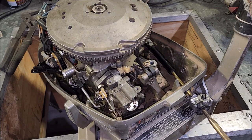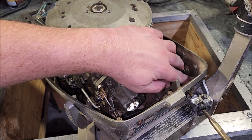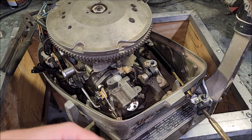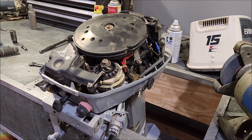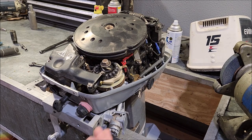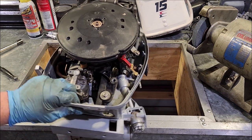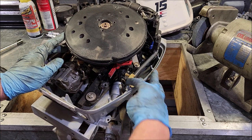Have you noticed what's weird on this outboard? Comment below if you have. This will work pretty much on any engine that has the little provisions for it, or at least two little holes. If you don't have those two little holes, or if you want to see the other style, let's dig into that. Here we are on another outboard — this one's a little bit newer. We do not have provisions on the side for the cable clamp. Here is the throttle little connector clip where our throttle cable will attach. It will run through this hole and clip on right there.